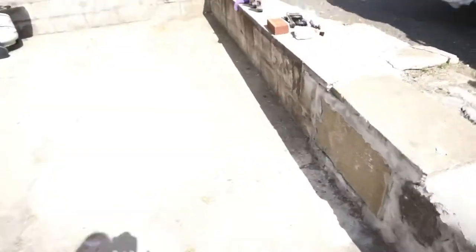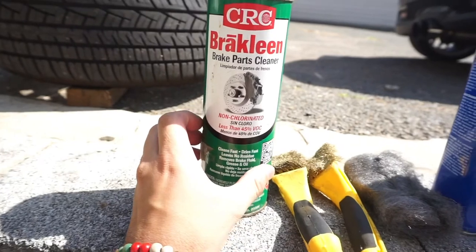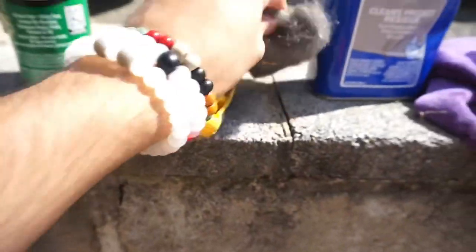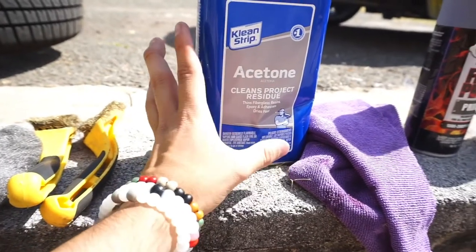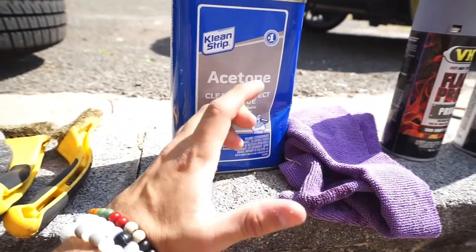That's the whole process of getting your brakes done. If you want to change color it's super cheap. To go over the steps in order: first use brake cleaner — spray it all over the calipers. Use wire brushes to scrub the outside, then use steel wool to get into the crevices. Next use acetone with a microfiber to clean up any leftover grease, rub it down and make sure all dirt comes off.